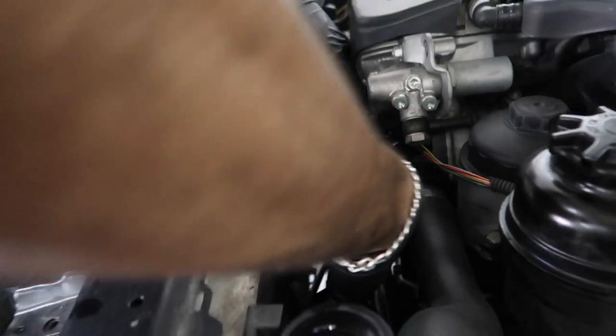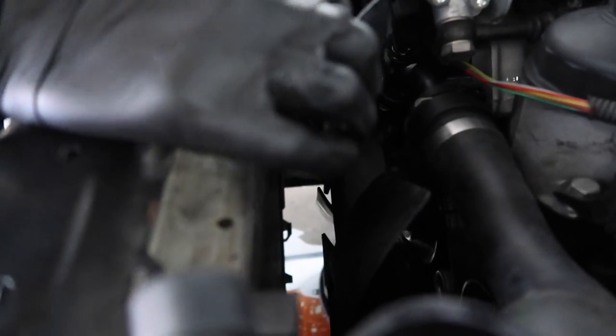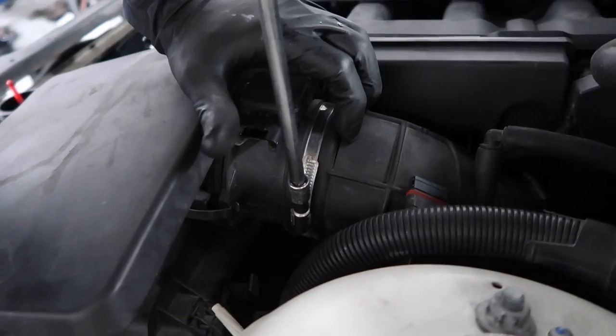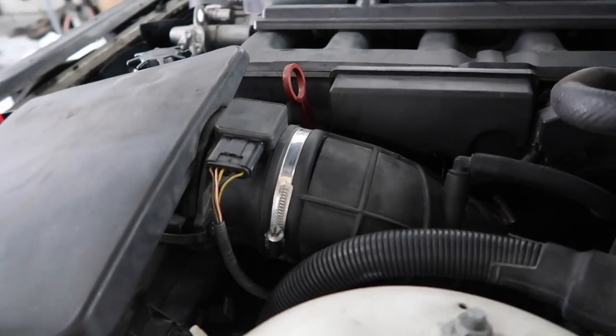That's the tips. Let's finish putting everything else back together. I've got a lot more work to do on this car so I'm not going to be fully bleeding it yet, but we'll put all this back. Turn it left to tighten the fan clutch since it is reverse threaded. Once the fan is back on, make sure your shroud is bolted in properly with the T25 bolt and the push pin. Put your air box back in at an angle. Use a 6mm socket or flathead screwdriver and hook up the mass airflow sensor. Put the two 10mm bolts for the air box back in. That's it for this video, guys — thanks for watching and stay tuned for more videos.